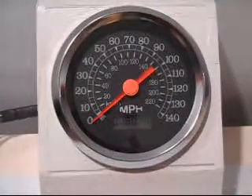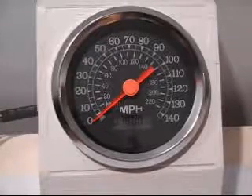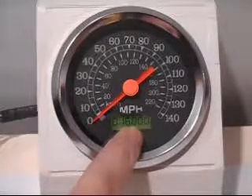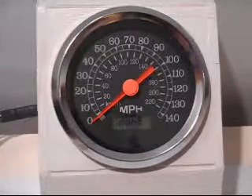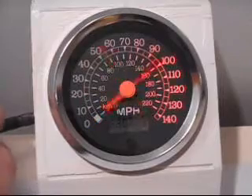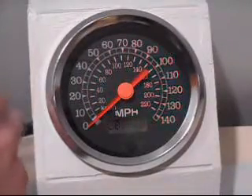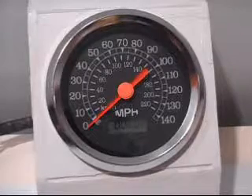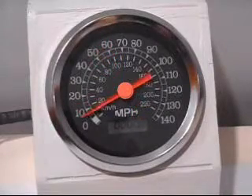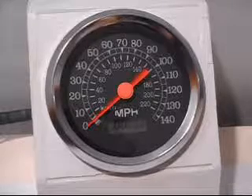The value can be 16,000 or any odd or even digit — it doesn't matter. It can be anywhere between 2,000 and 65,000 pulses per mile. Once you're happy with the numbers, wait until it's on the last number. After the last number flashes, the entire display will flash. Hold the button and it'll say 'done.' Restart your speedometer and it's now set for 16,000 pulses per mile. When you start up you'll see that red light — that's your high speed indicator, something you can manually set as well. If you have one of our GPS speed senders, set this to 16,000 pulses per mile, make sure your DIP switches are set for Hall effect, and you should be all set.